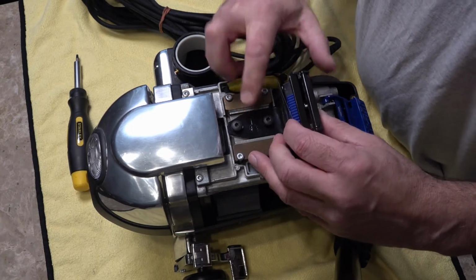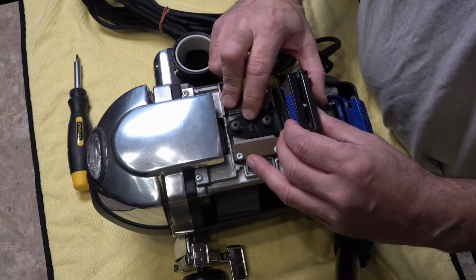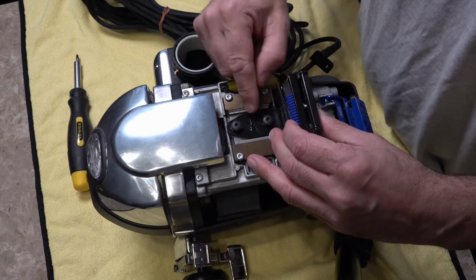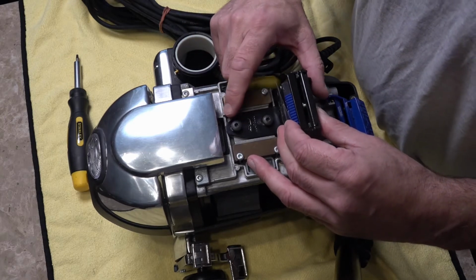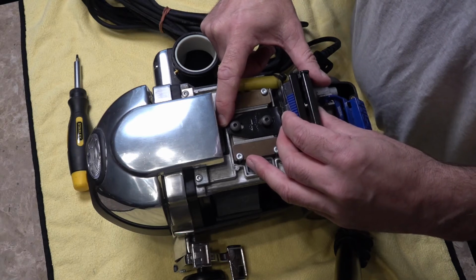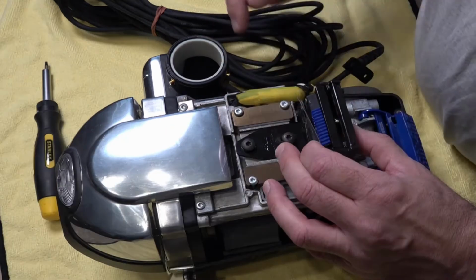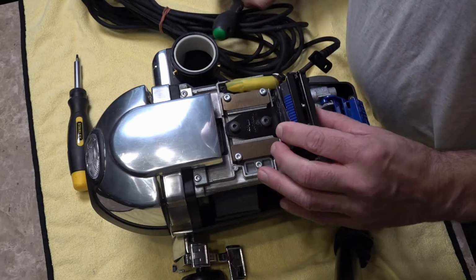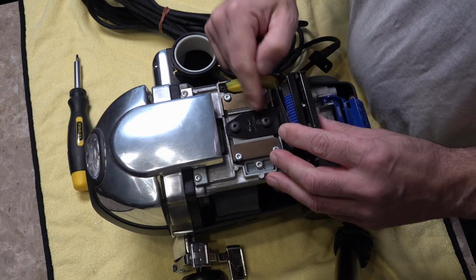So then what you do is hold that, press down and just slide that forward, because what happens is this activates this part which does your tech drive adjustment. So move that forward. So I'm just going to go back to where the screw heads were, which was roughly in the middle. And I'm just going to tighten this with a Torx 25. Okay, don't do it tight yet, just make sure it's definitely central, which it is.